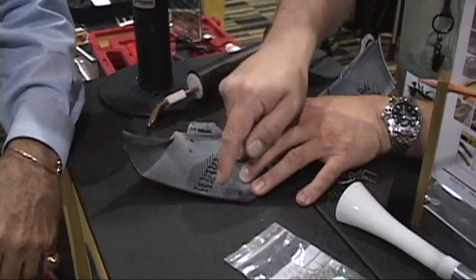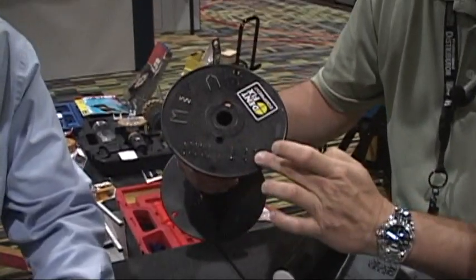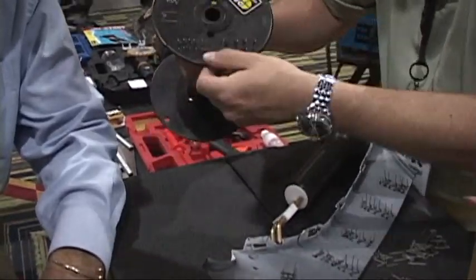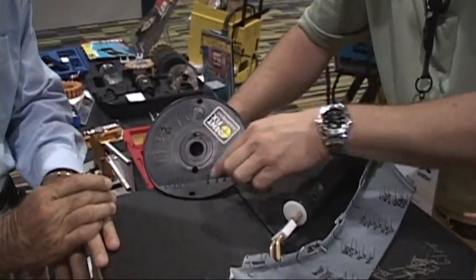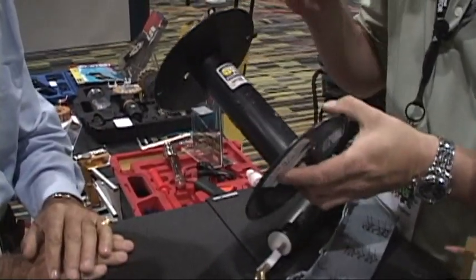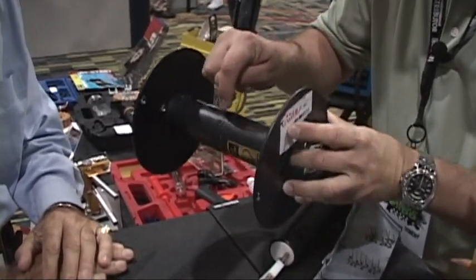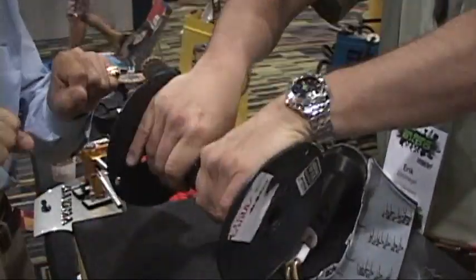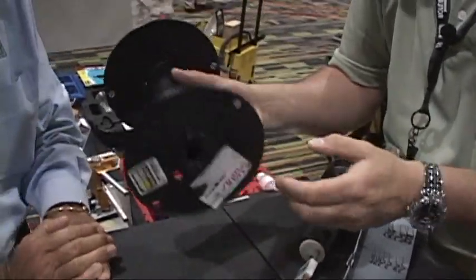When you're done, go ahead and clip off those clips, and you get a very strong structural repair. In this instance here, I've cut this spool apart and put staples in — now I get strength and flexibility. The flexibility is important for when you're trying to fit the part back on, and it creates the strength. You can also use it on structural repairs such as a headlight assembly, a clip, or an airbox. I've cut this in half here, and you can see the torque and lateral strength and rigidity — much more than you could ever glue together.